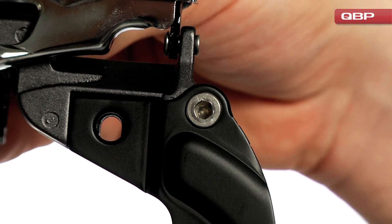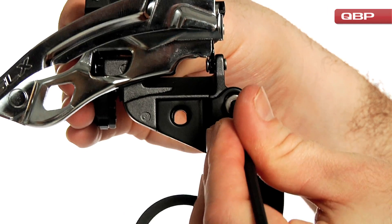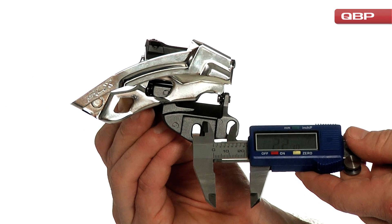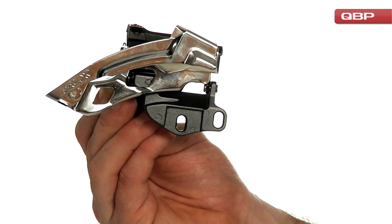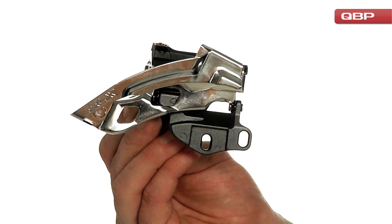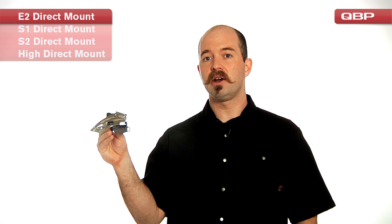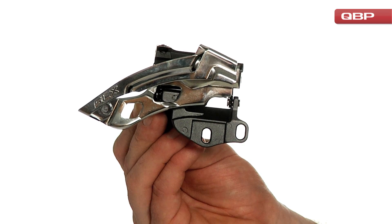The E-Type front derailleur is actually two types of direct mount front derailleur. When we remove the back plate, this is going to turn into an E-2 type front derailleur. The E-2 direct mount front derailleur can be identified because the bolts are 22.1 millimeters apart from one another. The other thing that you'll notice is that there's a fixed distance between the bolts as well as the front derailleur cage without any vertical adjustment. That means that when selecting a front derailleur, you'll need to account for your chainring selection as well. QBP only carries the E-Type front derailleur because the removal of the back plate allows this front derailleur to serve as both types.